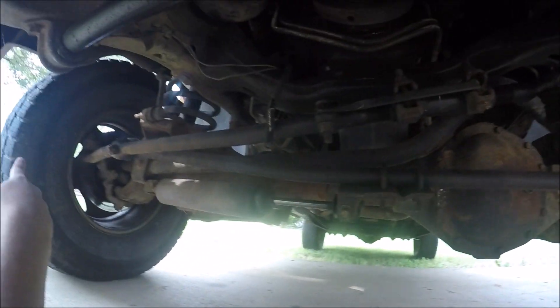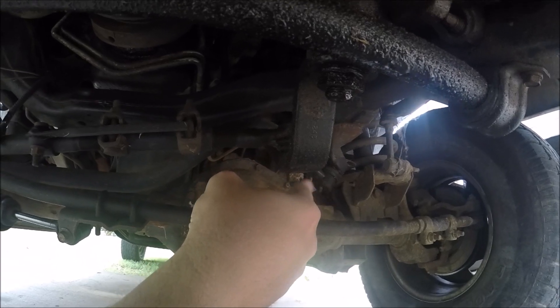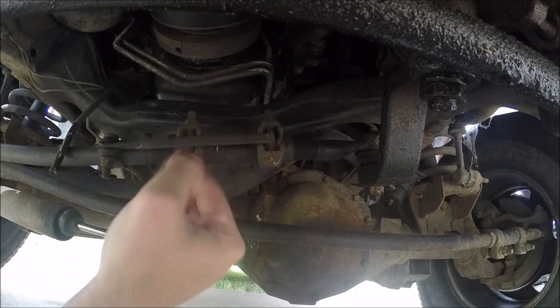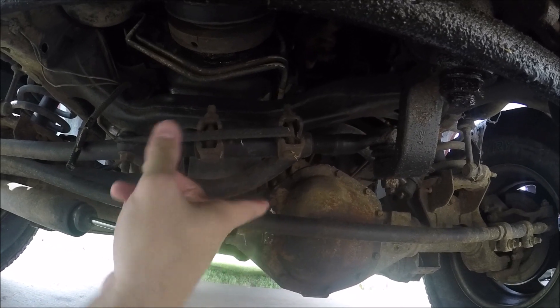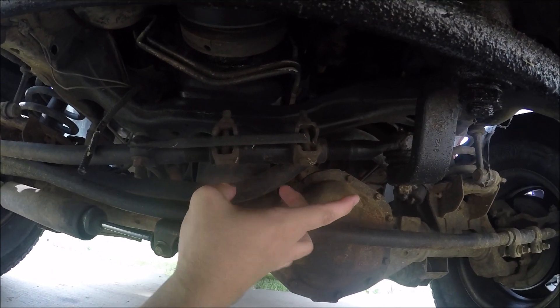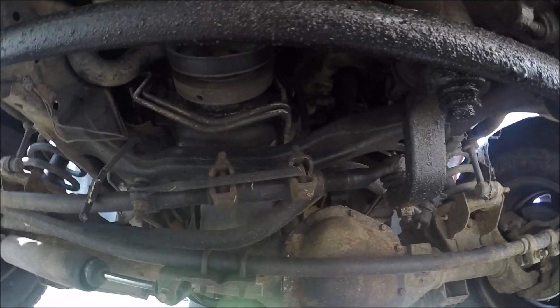This is all linked through your steering box to your steering wheel. There's an adjustment sleeve right here that allows the tires to stay in place while you move this bar side to side, which in turn moves your steering wheel. So all I've got to do is adjust this sleeve either one way or the other. It's essentially a turnbuckle — tightening it brings it in, loosening it opens it out. Let me look at it and I'll figure out which way I need to go.